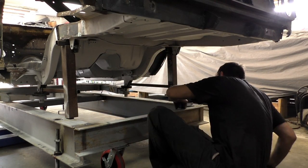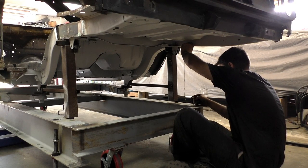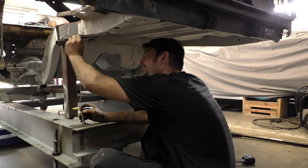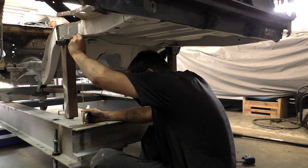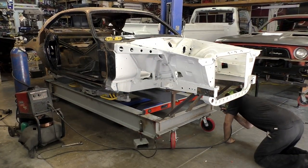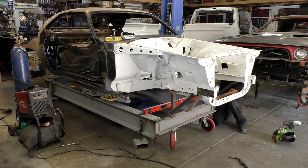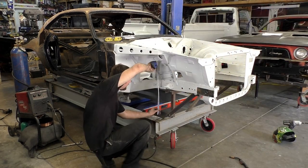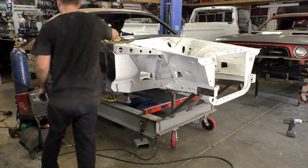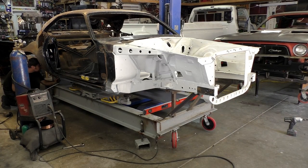We're going to ease this car down once I get it centered and then check it again. It's just easier because we don't want the front to get knocked out of proportion while we're adjusting the back - and we were off about a quarter inch in the back. I'm going off two main chassis screw holes for bump stops on the rear end - those are squared-up locations. You need to pick something on both sides of the frame rails, an important structural part of the car that isn't going to move and that matches. Once all four corners are set, we'll drop the car down, tack the four corners, recheck squareness, check frame heights, and make sure nothing moved while we dropped the lift. I also like to make sure the rockers are completely level before we weld it up solid.